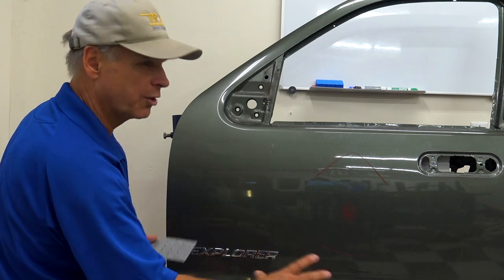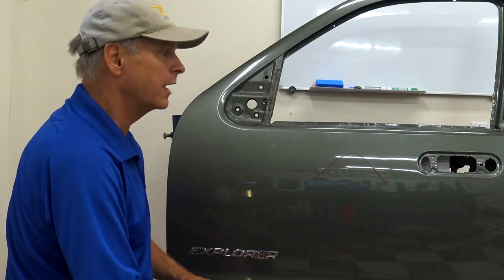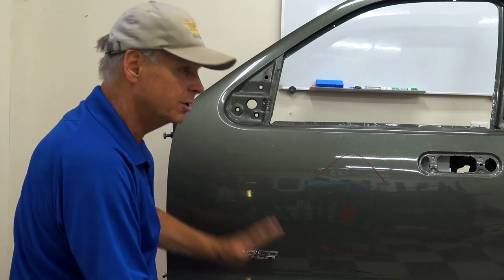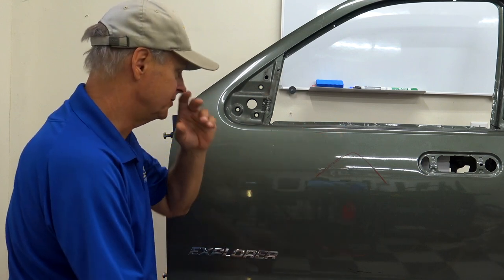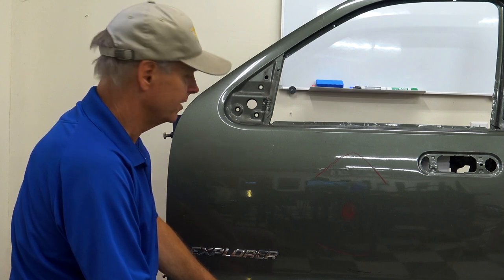And like I said, leave the tension up throughout the entire repair, take it off at about the 90-95% level. And I do, like you said, I keep tension on it while I'm working, because it helps get that final finish much faster. Okay. Again, this is no body line yet. We're not talking about body lines yet. Bread and butter right here. Oh, it is. This is going to be my gravy right there.